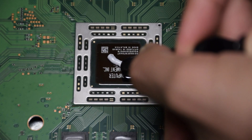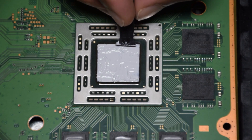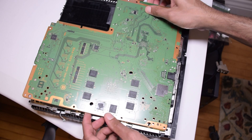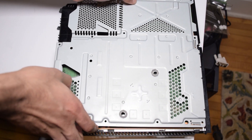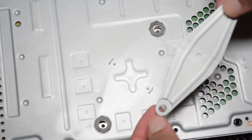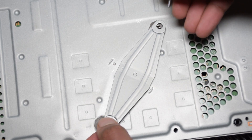Apply a little bit of your new thermal paste and spread it out, making sure not to leave any part of the die exposed. Align your motherboard and gently reseat it. Reconnect the three-pin fan cable and reinstall the metal frame. Then reinstall the bracket, making sure to screw in each side before tightening it down.